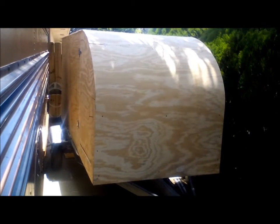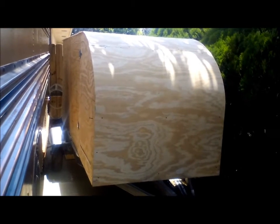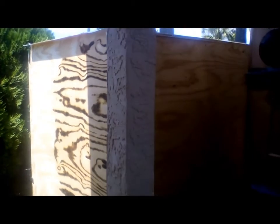Well, yesterday was just the decking, but that's due to a bad battery. Should have only been 2 hours worth of work, took 6. But I had my battery fully charged today, and it made a big difference. Now the trailer's basically built. Did the top in vinyl sheeting to keep it all waterproof. It's glued down with spreadable liquid nails by the gallon. And then I trimmed it off with aluminum stripping. It came out of the rubber mats that used to hold the matting down inside the bus. I don't throw anything away, it always comes in useful.